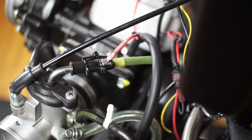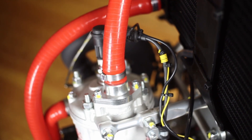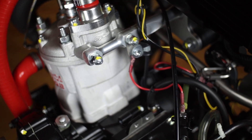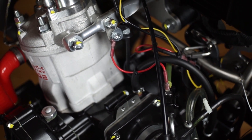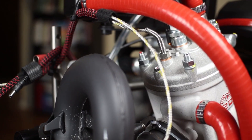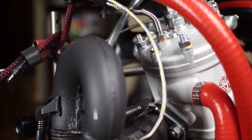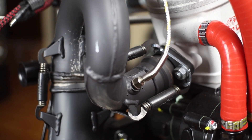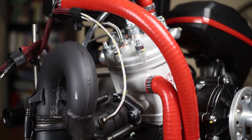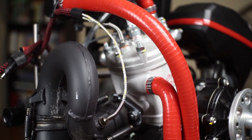Here's another look at the zip tie system, just for extra safety. Here's the cylinder head temperature gauge and RPM meter, with a little bit of extra slack and strain relief so some of those wires are looped around. Here's the water coolant temperature sensor and the factory-installed bung for the exhaust gas temperature sensor. Both of those will be routed to a custom mount system.